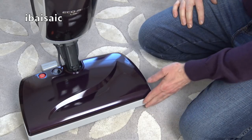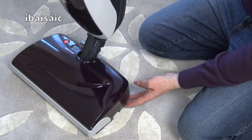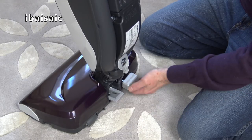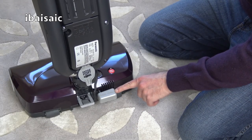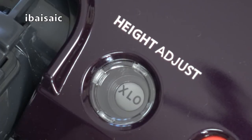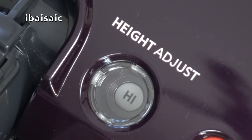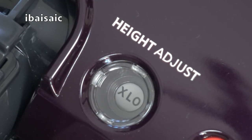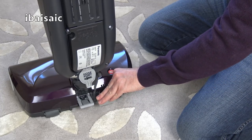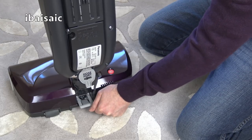Starting at the bottom with this very wide cleaning head: there's a rubber bumper around the front and partly around the sides to prevent paint marks. There's a foot-operated height adjustment switch — at the moment it's set to X low for very low pile carpet. Pressing it cycles through low, medium, high, and back. It's a bit similar to the Miele powerhead foot-operated height control. I'll start this on low rather than X low.